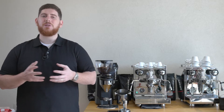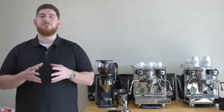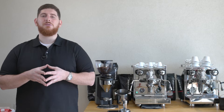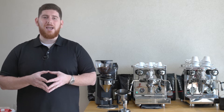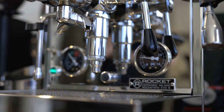Now let's talk about the difference between them in regards to the Chrono Metro Type-Vs and the Evoluzione Type-Rs. Both machines come in both models. In the Type-V machine, you get a vibratory pump, a PID controller, and shot timer. In the Type-R, you get a rotary pump, which gives you the ability to plumb in the machine or use the reservoir that comes with it, and you also get the PID controller and shot timer. So if a rotary pump or plumbing the machine in is important to you, then the Evoluzione is the right machine. If you'd rather use a reservoir and don't care for a rotary pump, then the Type-V is the right machine for you.